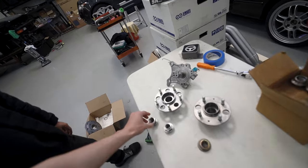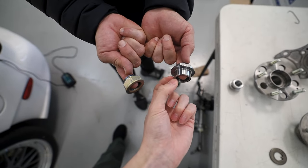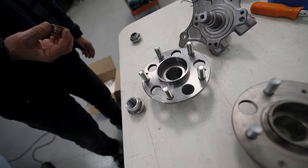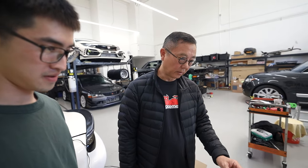The solution that Ben came up with is this nut. Compared to the OEM one, you have that compensation to run the five lug, because otherwise you run into the issue of empty space not being used — it's like half of the bearing being supported. That 11 millimeters isn't supported. Why did you come up with this solution? When I did the conversion I noticed there was a big section of the bearing that wasn't supported. In my opinion it's important to have full support, so we looked at different ways of doing it and this is what we came up with.